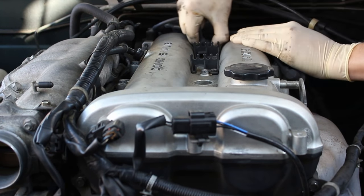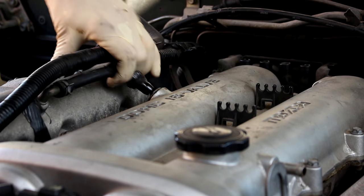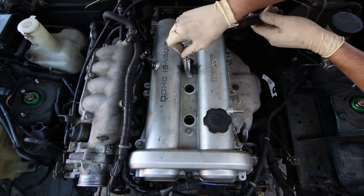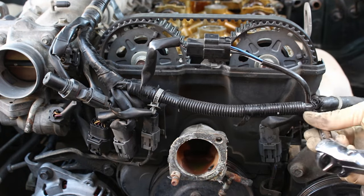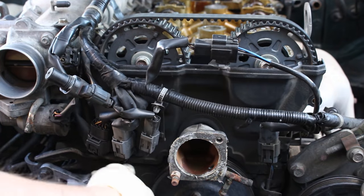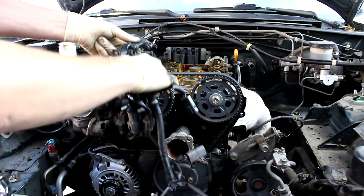Now let's get ready to pull the valve cover off. Pull the cam sensor out. If you have a 99-2000, pop out that PCV valve, loosen up the coil bracket — which is actually bolted into the back of the valve cover — though you don't have to fully remove the ignition coil bracket. Loosen up all the valve cover bolts in a couple of phases, and then you can pull your valve cover off. I really want to get all of this harness stuff completely out of my hair. There's just so much going on with the NBs compared to the NAs. Pull the 10mm bolts out from the upper timing cover, which pretty much holds the entire harness in place, then unplug everything and you can pull it out of the way.